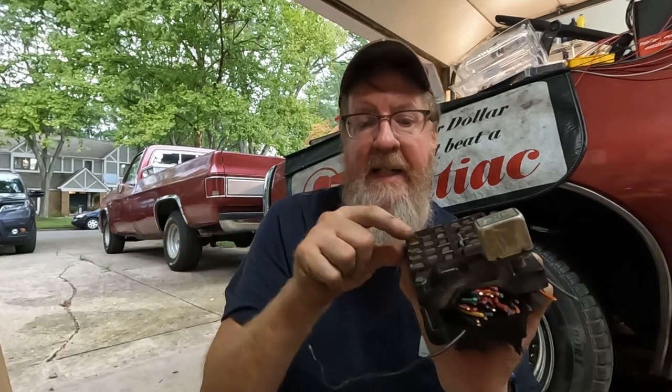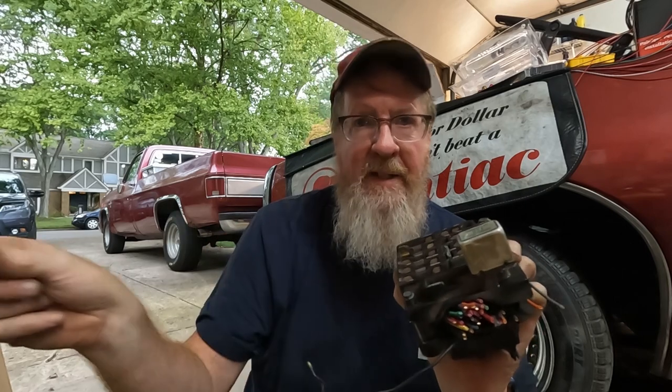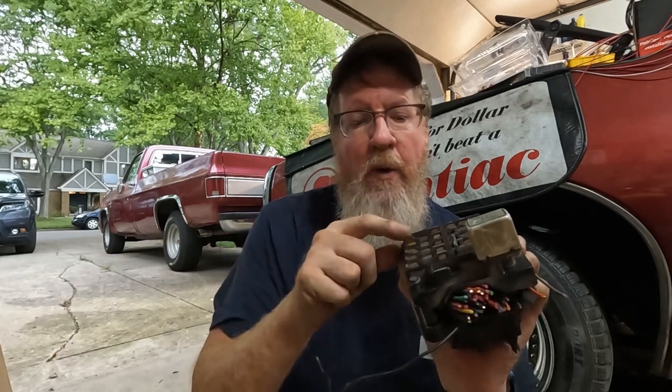So what happens is when you've got that wire connected in here to the key on only, as soon as you turn your key on, that's going to send power to the voltmeter. It's going to see hopefully 12 volts. And when you're running the car, you'll hopefully see 14 volts. But you'll connect it to power that's on whenever there's a keyed switch.